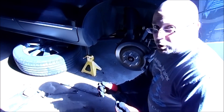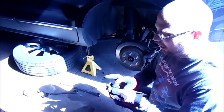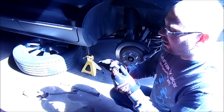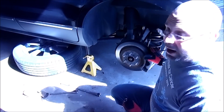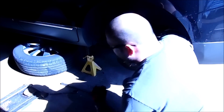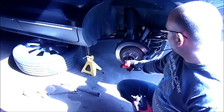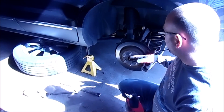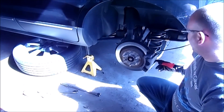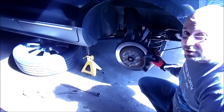To remove the caliper, you're going to need a 14mm socket — I have this on a half-inch adapter because I'm using my half-inch ratchet, and this is a 3/8. I have an 18mm here for removing the caliper bracket. The one other thing I have is a T30 Torx — right here you have a hold-down screw for the rotor, so that needs to get removed as well. Take off the four bolts and the one screw and just swap the parts out. We're also going to need to compress the piston — I've never done a set of brakes on a 9-4X yet.